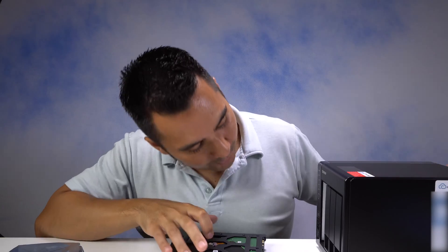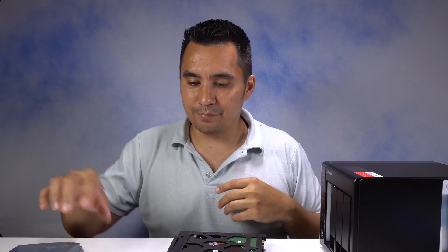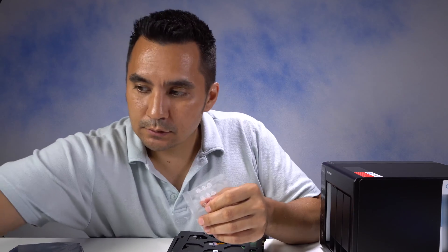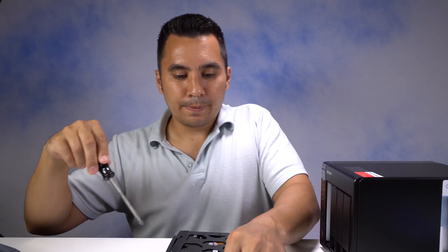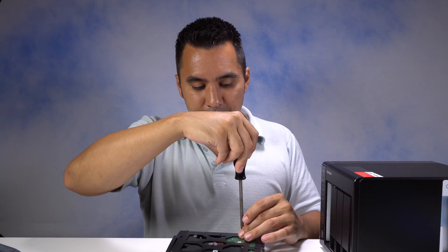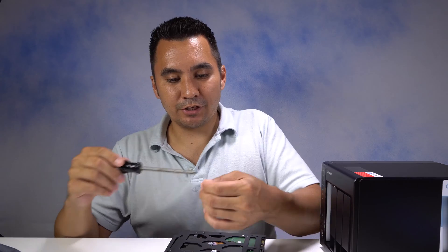The top is showing what you'll do for an SSD and the bottom is showing what you'll do for a mechanical hard drive. You want to look and make sure that your hard drive will line up with the ports inside before you screw it in. It's definitely good to use all the screws because that will help with vibration. Vibration is not good for mechanical hard drives specifically, so you'll want to make sure you have it as secure as possible.